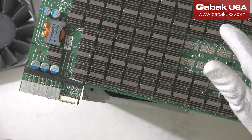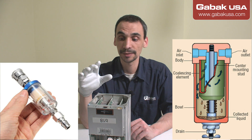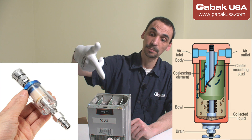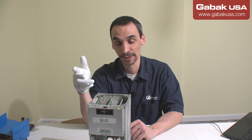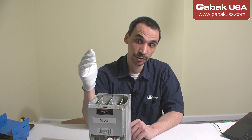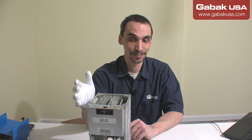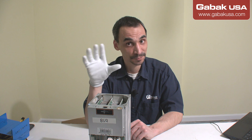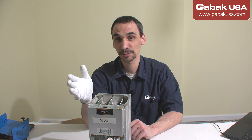If you're going to use a compressor, make sure it has a water filter, because if you're blowing air and there are drops of water inside the hose, after you clean it and start using the computer you could have a short circuit, which will damage the unit. So try to use good air filters everywhere so the environment is as clean as possible.